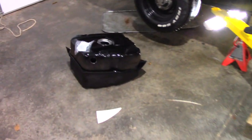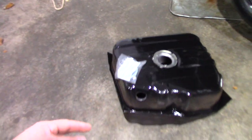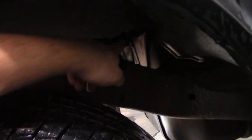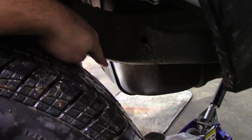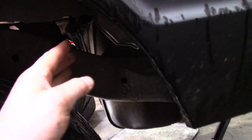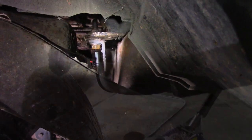Okay guys, here we are. We now have Jesse's new gas tank - it's finally came in. He went ahead and painted this bad boy and then put some undercoat on it, so it's ready to install. First things first, we went ahead and put some PB Blaster on the bolts and we're about to unhook the fuel line. It's held in with these two straps right here, and once the fuel lines are unhooked we'll remove the bolts, use a jack stand to hold up the gas tank, and slowly take it down.